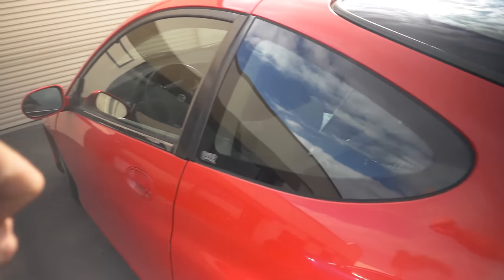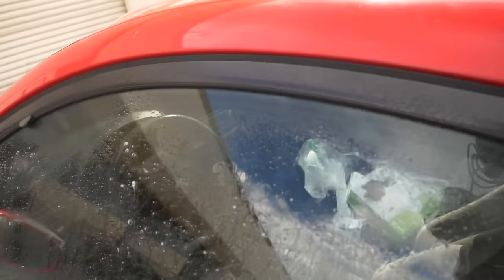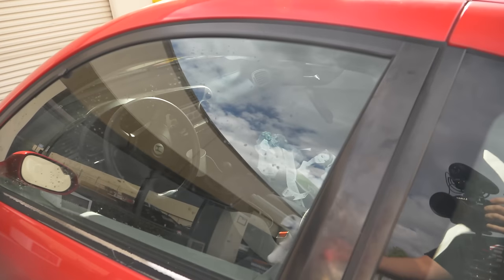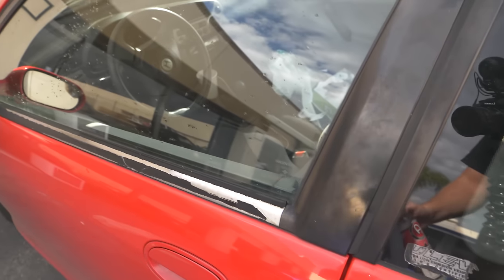So I'm going to scrape the windows. I'm going to use a razor, but I'm not going to scratch the shit out of it like whoever did the front windshield. It's simply to remove contaminants — you could also use a clay bar. This rough surface needs to be completely smooth because you're going to trash that film getting it sized up, cut, and molded. And of course the inside needs the same treatment. I'll use a razor blade gently flat against the surface to remove the thicker contaminants, but I don't want to damage the squeegee on all this rock debris.